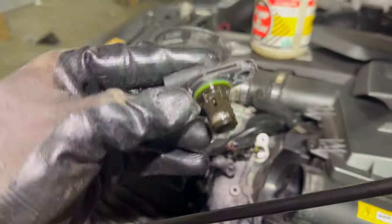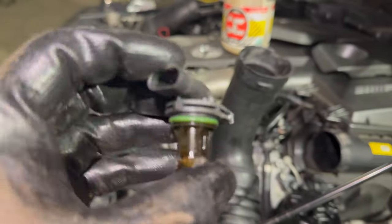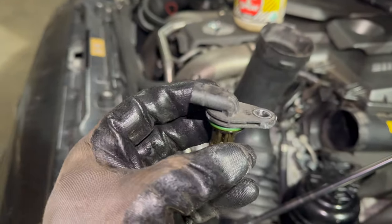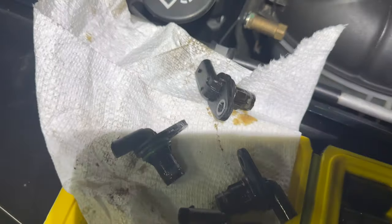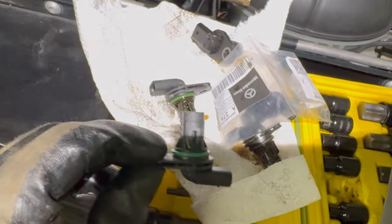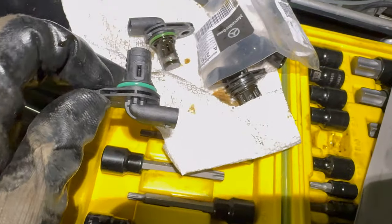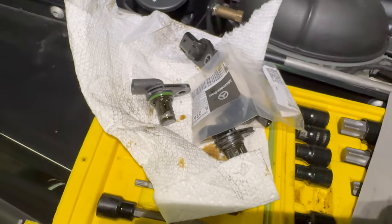This one actually has a new o-ring on it, so it looks like it was previously changed — that's why this one isn't seeping and the other three are. The three have old black o-rings on them, and one has a green one just like these new ones have green o-rings too. So the sensor must have failed before, somebody replaced it, and now we're replacing it again. I'll probably just hold onto this one as a spare since it was fine, but now at least all of them are done.